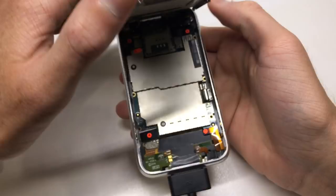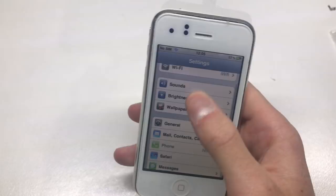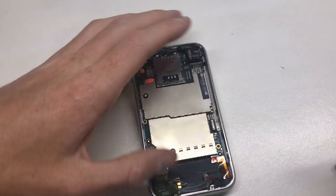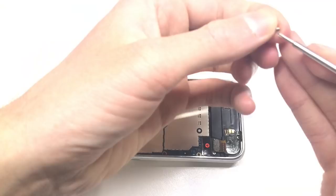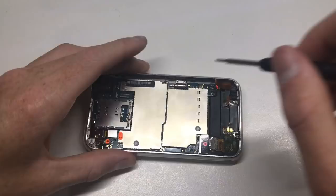After connecting the old screen you can see the phone continued to boot up. I had a heap of iPhone 3G and 3GS parts I'd bought for about two dollars. I connected up one of those screens and the LCD worked, but the digitizer was faulty. So all I had to do was take it back off and transfer that good LCD onto a new digitizer and home button assembly, which is relatively easy on the 3G and 3GS. On newer iPhones the LCD and digitizer are laminated together, which reduces the gap between screen layers and makes the phone thinner.